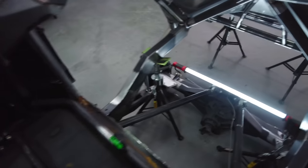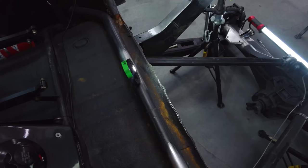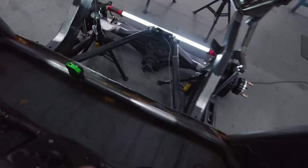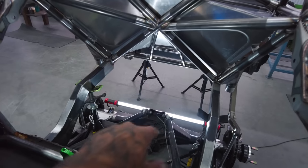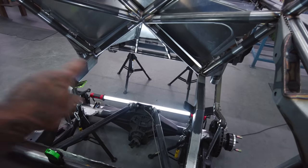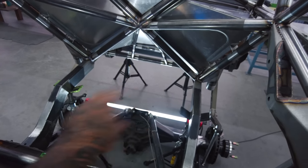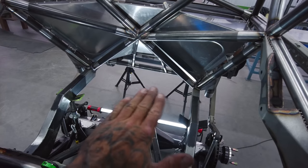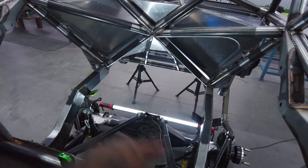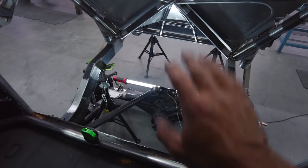Also in here is our third seat — we left a lot of room. You can see where the old B-pillar tube is, the ground tube, and where the frame kicks. We'll add more structure wherever the base of the third seat is, compress the axle, have the upper links come through, and figure out what real estate we can get for a shelf for the seat — probably some sort of X brace by second nature.